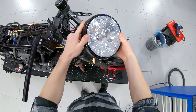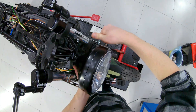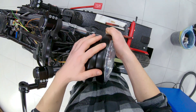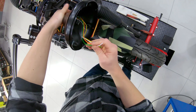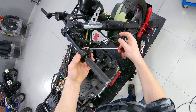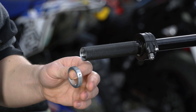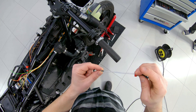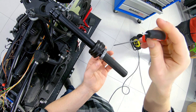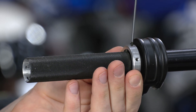We install the headlight LSL-80s in an aluminum body on the old brackets, which are slightly bent for a better fit on the forks. There is enough space in the body to place all connectors and the M-button relay. A compact built-in throttle replaces the OEM one, which had to be removed due to its integration into the switch control. We install aluminum MotoGadget grips with an unusual mount on the tube. I fit it on the tube first to make sure there is no skew and there is sufficient gap between the grip and the throttle body. The stops are tightened so that the center of the ring coincides with the center of the tube.